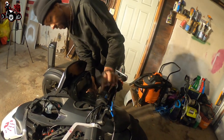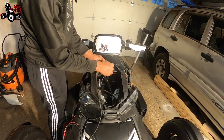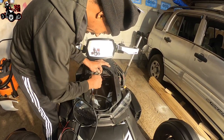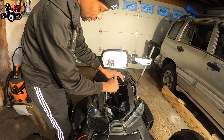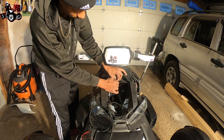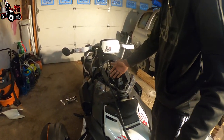And tomorrow I'm going to run to AutoZone, grab some zip ties and just zip tie it up. So we're going to zip tie it to these wires over here on the side that's coming from the throttle body. It comes down here through the top of where your trunk usually is. We're going to connect the female side. There's like a little slot and like a little tab so you can get it the right way - hit the positive and negatives on the right side. I'm going to tighten this down here. Now I have this ran here. We have the top of it ran and connected. The reason I've done that first is because I want to know how much wire I got to play with.